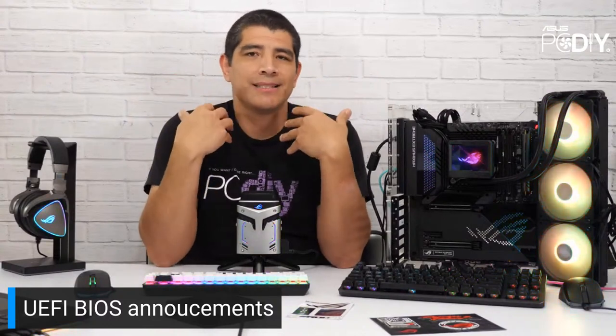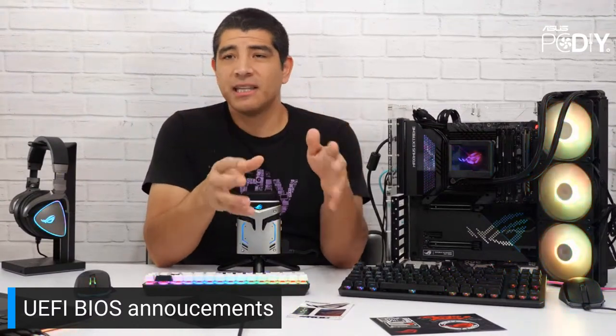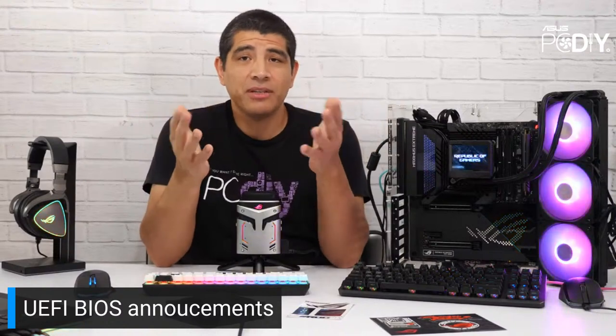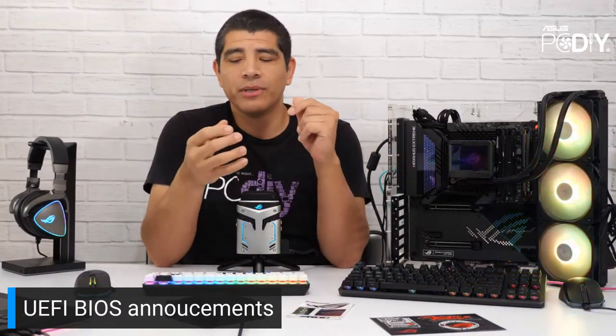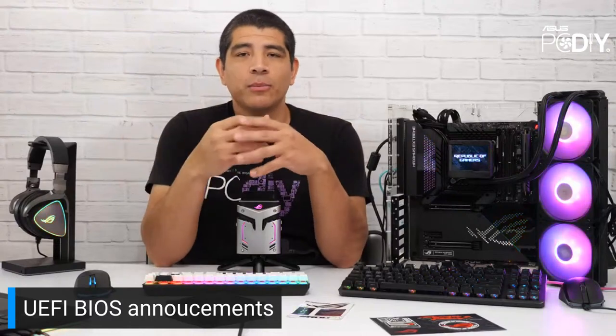So generally, it's not something you necessarily want to rush out and update to. As always, too, I strongly caution that if your system is already overclocked, it's stable, it's reliable, you have a good operating experience, don't update the UEFI, especially if it contains low-level firmware, whether that's Intel Management Engine firmware, or on AMD, it could be AGESA firmware or chipset firmware.